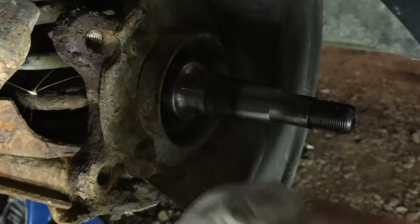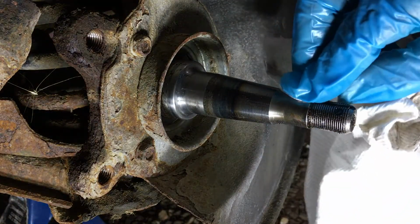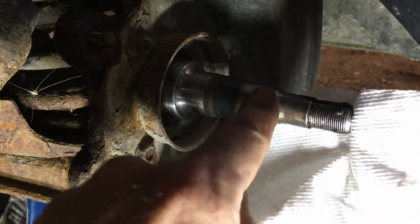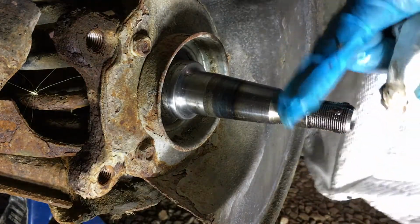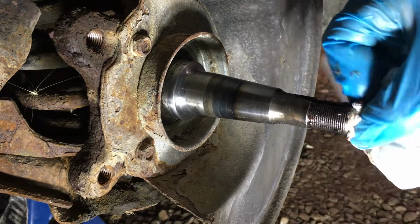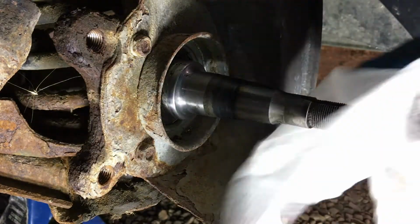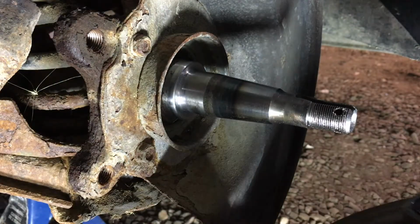Now, looking at this, we're not seeing any massive cracking or overheating, not a lot of color changing that you see there. The bearing surfaces appear to be here and here, I believe, because this is kind of grouped up. So this would be machined, that's machined, and I believe this portion is going to be used for our assembly. So we look pretty good there, but we want to get all the nooks and cranny stuff out of here as well. Get those threads as clean as we can, and then I'm going to go grab the rotor and the jelly. The grease.